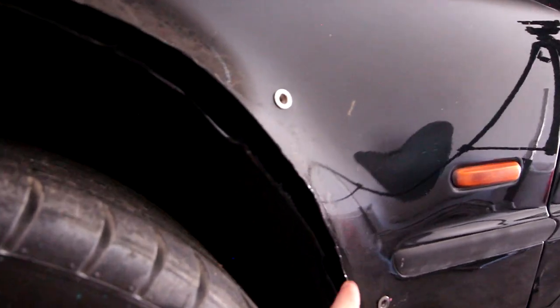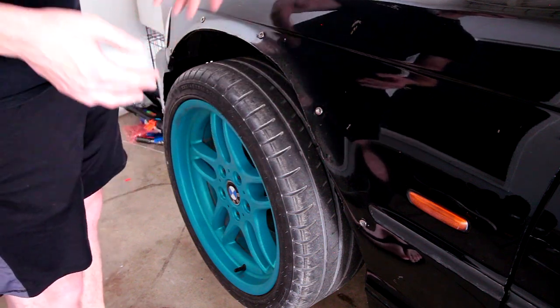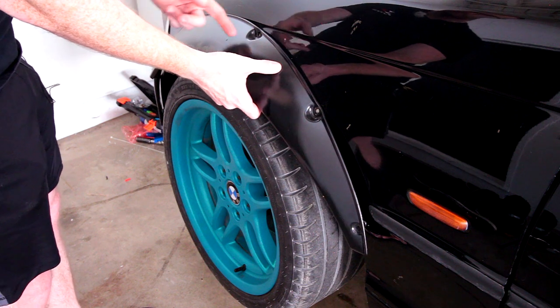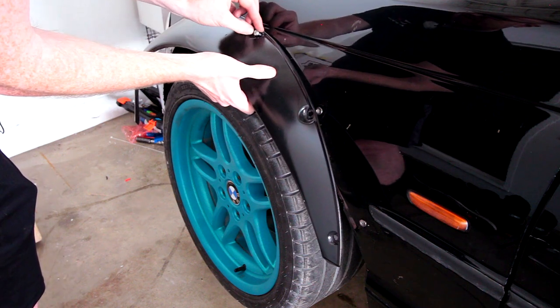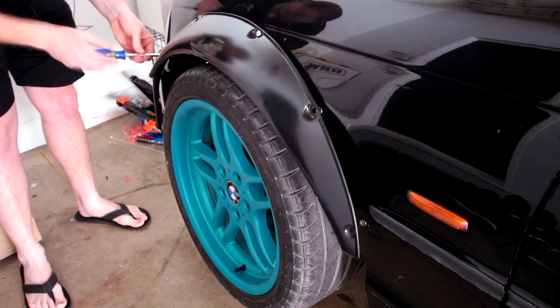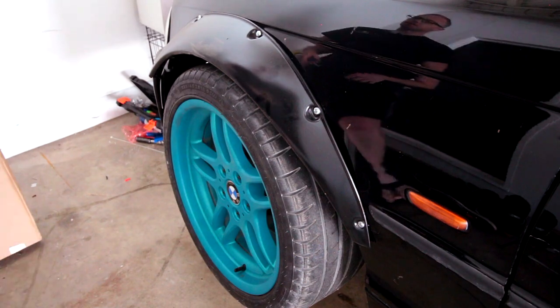I was able to retain my inner fender liners but had to cut them as well — though it might be easier to just remove them depending on how aggressive your wheel fitment is. Hit the exposed cut metal with black paint to prevent rust. The nice thing about this setup is that with a rib-nutted fender and properly clearanced fender and bumper, the flare is quickly removable — in my case with just a Phillips head screwdriver. The fender flare comes off in seconds, and installation is likewise a piece of cake.